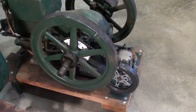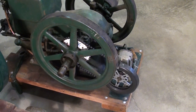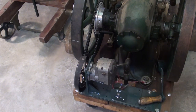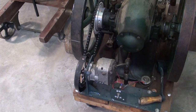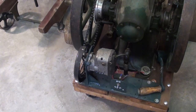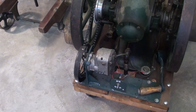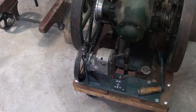Somebody named Steve was watching and thought there's a better way of doing it, so I'm going to show you how to put another kind of magneto on there. This is a Fairbanks Morse magneto that came off of a single cylinder Wisconsin engine, and I've got that chain driven. It took me two days to make that little sprocket — that's a split piece and was no easy job. Here's the on and off switch, and most of the engines do not have an on and off switch, so that's a pretty handy feature. I'm going to disable this one, probably leave it on there and just take the wire off later in this video.